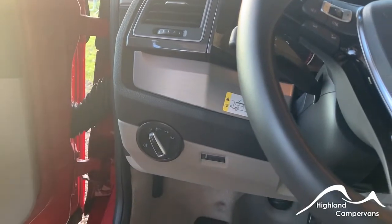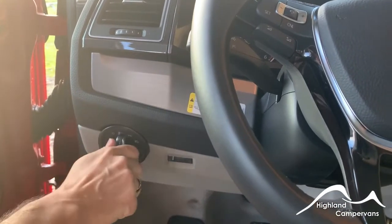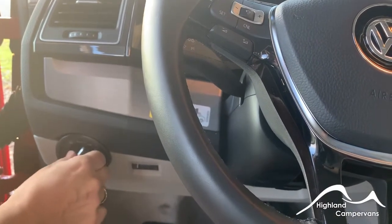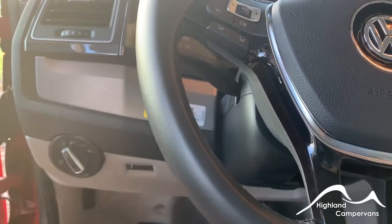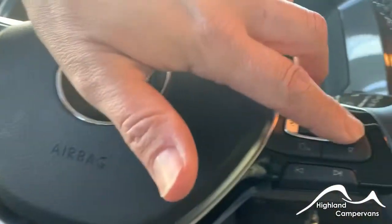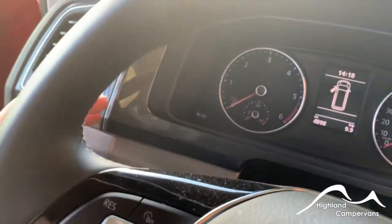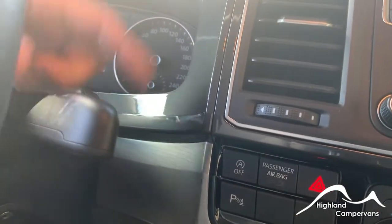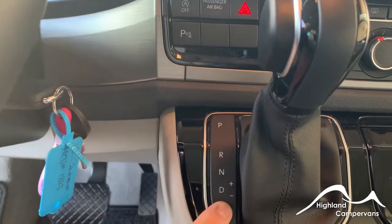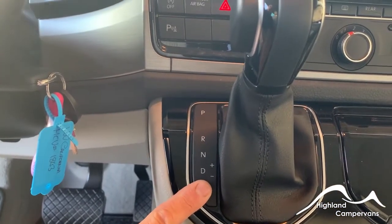On the dashboard you've got controls on the left hand side for the Volkswagen exterior lights: there's an off mode, an auto mode where the lights engage when the vehicle is started up, a side light mode, and a dipped headlight mode. If you pull out on the bezel that will engage your rear fog lights. Chimes will sound if the alarms are active. On the steering wheel you have your cruise controls on one side, and speaker and volume controls and adjustments for the head unit on the other. At the back you've got your main beam and indicator controls, and your wiper controls on that side. It's a DSG box so you need to start with your foot on the brake pedal and the vehicle in park before you can pull back into reverse, neutral, drive, or sport mode. In drive mode you are able to use it as a sequential box and go up or down through the gears.